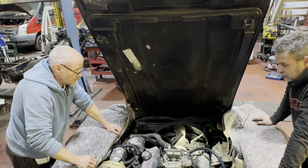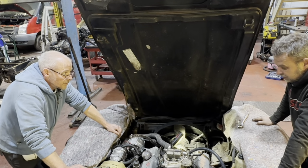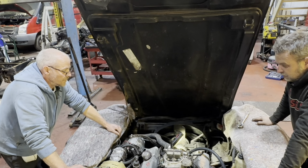Check your cranks. Make sure we've got pressures, and see if we've got an oil pressure gauge. Hopefully there's not any fuel in it, so it's not going to attempt to fire. But it definitely wouldn't hurt to turn it over. I mean, the fuel pump's not connected anywhere.